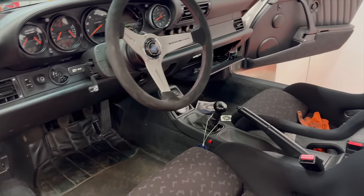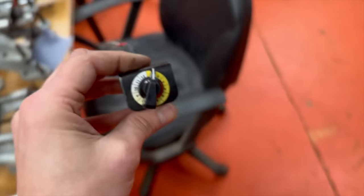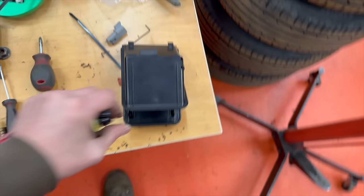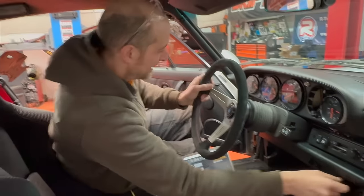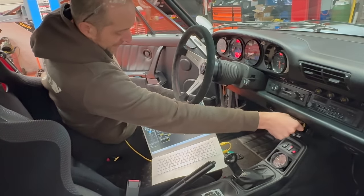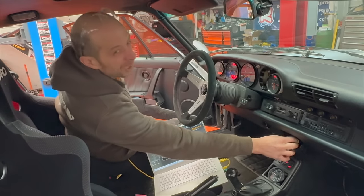Next job: mount the rotary switch. Phil's been driving for a couple of years with the boost control switch wobbling in the glove box, quite confusing not knowing which way up it was. I've made a little bracket, used an AIM sticker because the Haltech one's too big, and I'm going to fit it inside the old ashtray. Nice hidden boost control! On the computer you can see positions one through four, then maxed out - all the power.